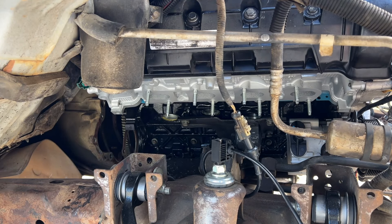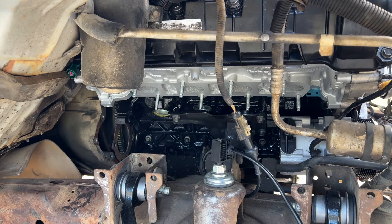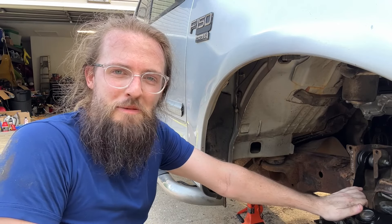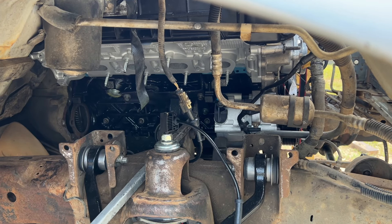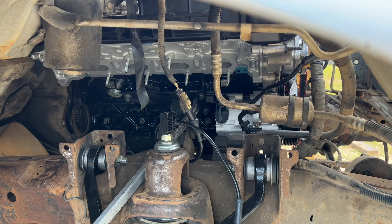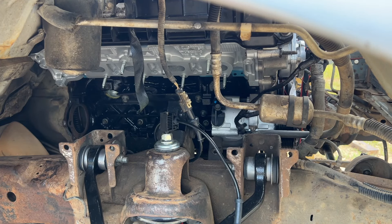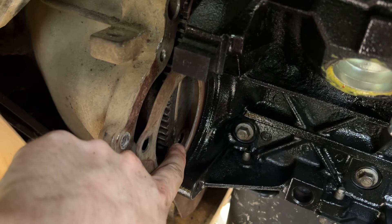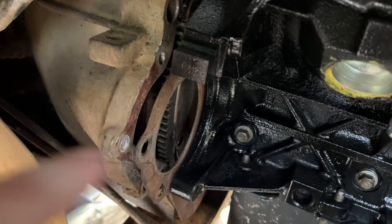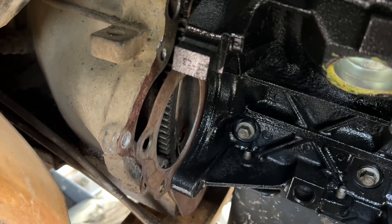It is not easy to lower it elegantly, that is for sure. I managed to just push it in — nope. I knew this would be tough, but I didn't think it would be this tough if I'm honest. Putting the E46 engine back in is not even a third of the challenge of this. It's almost there. I need like two big pushes. That's it! Let's go! So deep inside there, that little bolt and that hole — that's what I've been trying to line up. That is the torque converter that will connect to the flex plate, and that's exactly what we want. I should be able to pry this back a little bit and hopefully it will seat a bit more now.